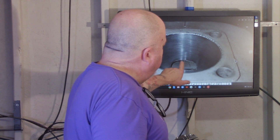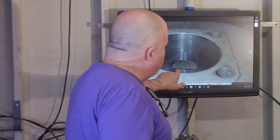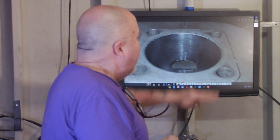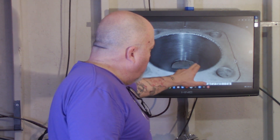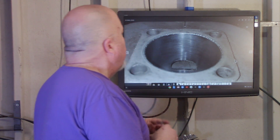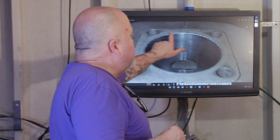You can see the exhaust port is very irregularly shaped and you can feel there's a lip on it too. When cleaning up, make sure you don't have any burrs going inside the bore — you don't want your piston ring to get caught and break. So go in and file all that junk out. Another thing: check and look for any scratches.